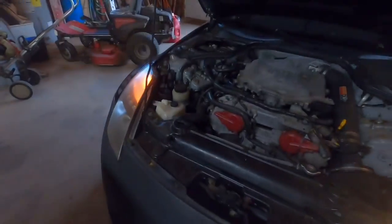This is low beam. This other side of the headlight doesn't light up at all, not the halo or the other thing. And then on this side, you come over here, and none of those circles are lit up, and none of those headlights are lit up. Only the halo on this one is lit up. When you turn on the high beams, both of these lights light up on this side, which is good. Neither of the halos light up, and all those still don't light up.